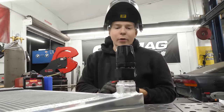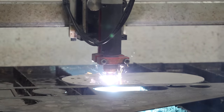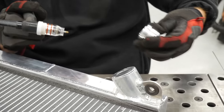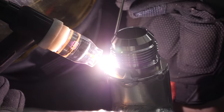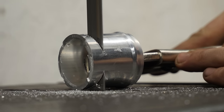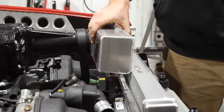I love working with Mishimoto aluminum because they use good aluminum — no cheap stuff here. For the second radiator bung, I had to cut out a little adapter on the plasma cutter because the hole coming off the radiator was much bigger. After the radiator was done being welded up, I went ahead and started working on the water box. The first thing to do on that was to weld a normal bung onto it that will connect to the crossover tube coming off of the engine.